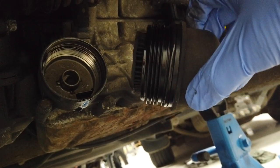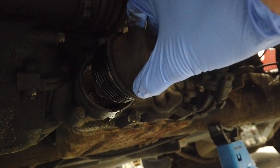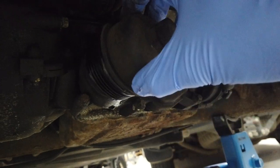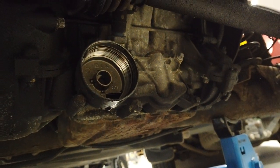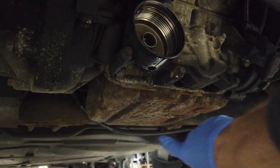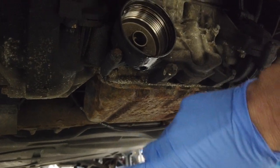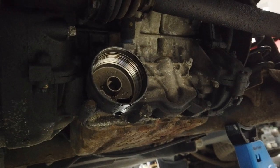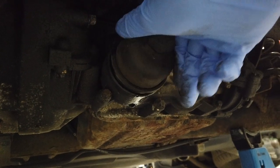Not a lot of oil came out and I thought my car must be running low on oil. But then I did a bit more reading and it turns out that when you do the oil change and take this off, it only drains the bit from here. The sump is under here but there is no drain sump plug. The later and bigger engines did have a drain plug, but this one doesn't — basically you've got to suck the oil out. There's about two and a half to three liters of oil in there depending on whether you've got the 600 or 700cc engine.